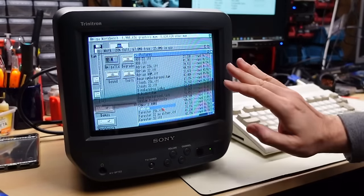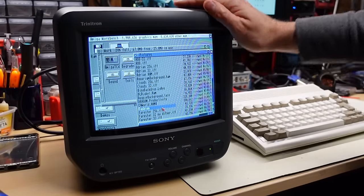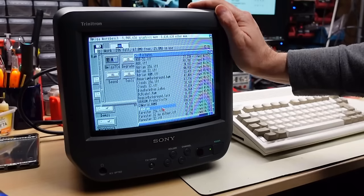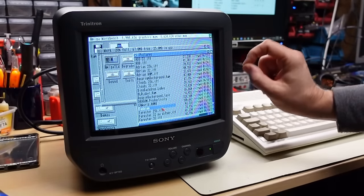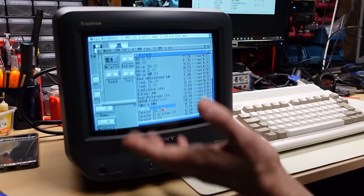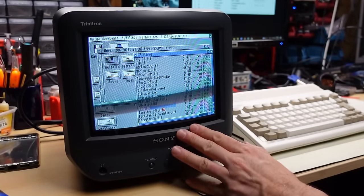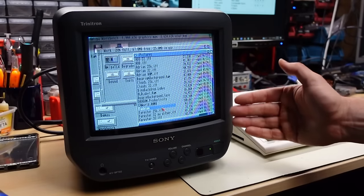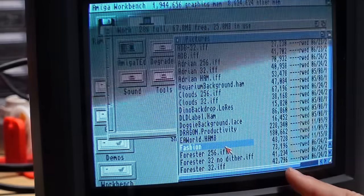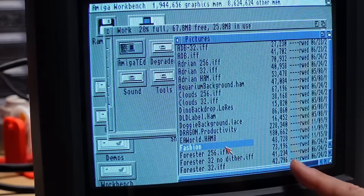The image is quite readable, even though this particular CRT on this 9-inch set is not the most high resolution. By resolution I mean the dot pitch — I think it's something like 0.40mm, which is the spacing between the little RGB stripes on the set. The lower that number, the higher resolution the CRT can resolve. This one is designed just for regular consumer television use, so it's not that high res. While the text is completely readable, it's still not the best. But for playing games and such, it's going to work absolutely perfectly.